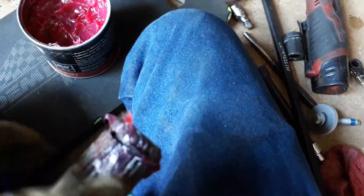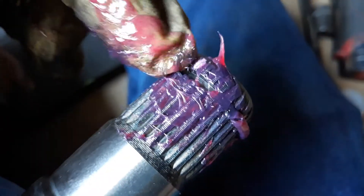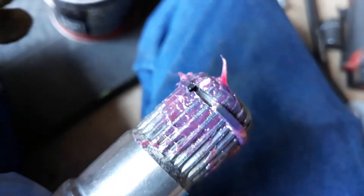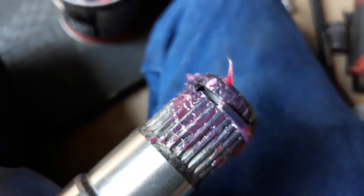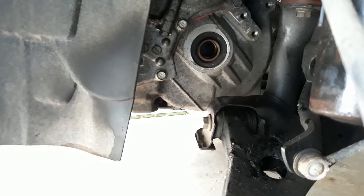For this pin, you can use a little bit of grease around it. You can see it has a cut here, so put this side on the bottom — it will be easier for you to put it in. Do not damage the transmission or the CV axle; make sure you put it in the right direction.